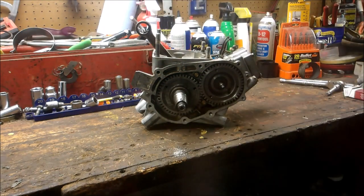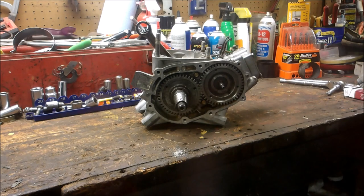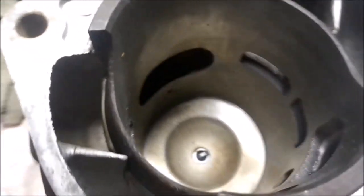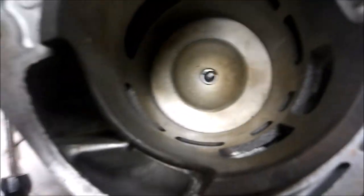Now, just got to order a piston. And that jug that I got lucky on, because the guy just freshly bored it out before water got in the engine and rusted up the counterbalancer. So I don't have to worry about the cylinder at all. Maybe just throw a honing stone through it, get the new piston, get this bad boy back together, and I can get the Sportsman fired up. Here's the cylinder. Looks really clean. It's not even any scratches.